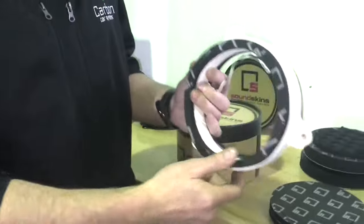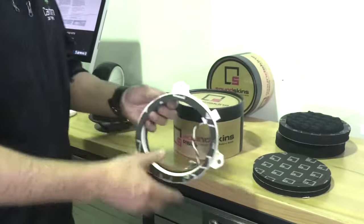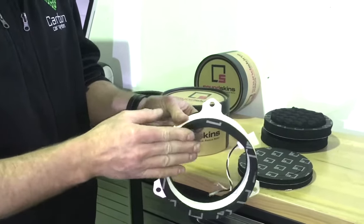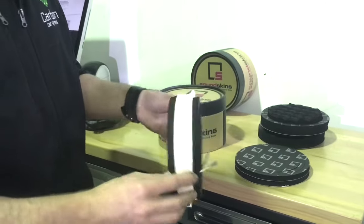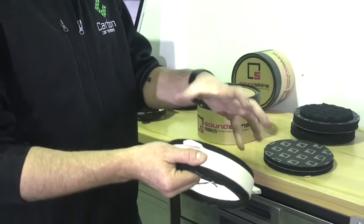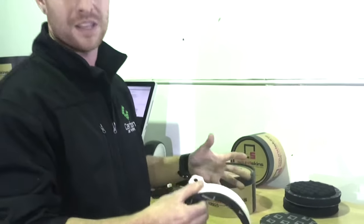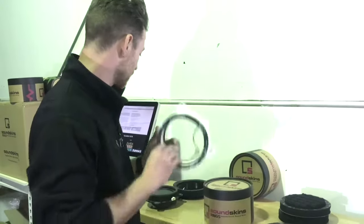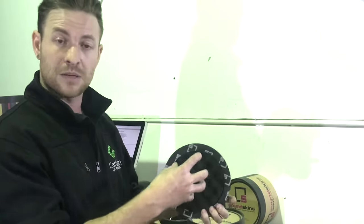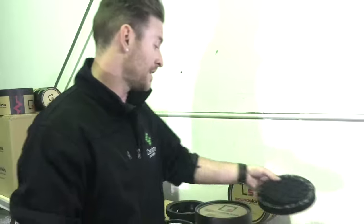We've 3D printed this ring as an example, copying a factory Toyota design. You place the aftermarket speaker in position, then put the adapter ring on top of the face of the speaker — that gives you a seal against the trim. On the back, you do the same thing for a perfect airtight seal. We don't put a full ring on the back because enclosing that section changes the speaker dynamics and frequencies. Instead, we use a plug behind it, which reflects resonance and stops it reverberating through the metal panel.